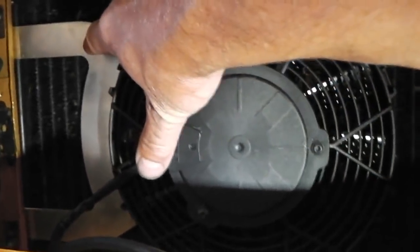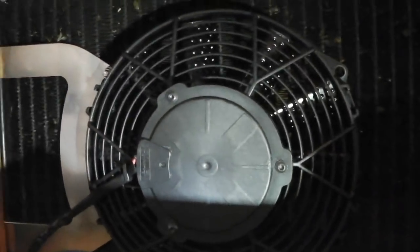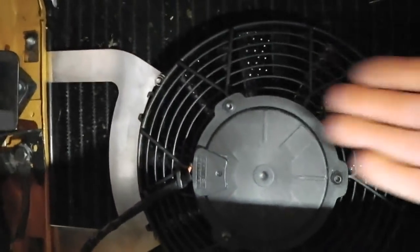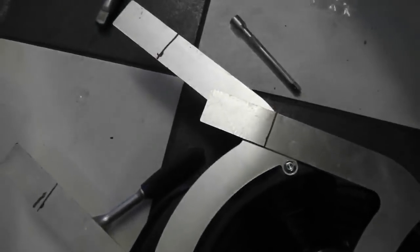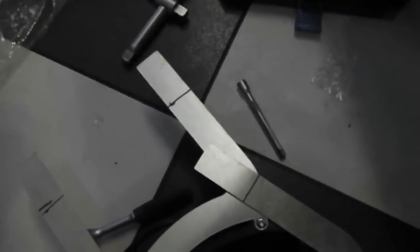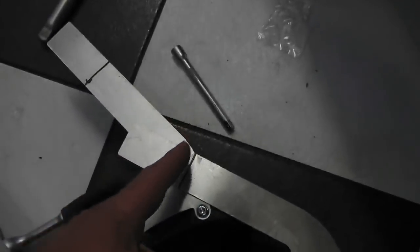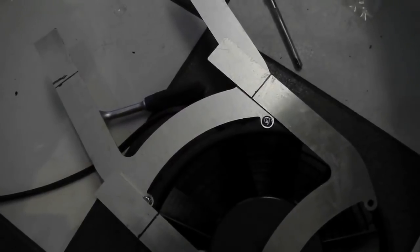Then we can mark this bracket now in the engine bay. I can't fit the other bracket, actually, it didn't work sliding it all the way to the left because it catches on a clip. So I'll mark this one, we'll cut both brackets. In theory, both brackets will cut the same. Then we can slide in that way and then slide back that way. Should just about work. That's how we're going to fit. Okay, I've marked out the brackets for cutting. 60mm off the end lands us right in the middle and just sandwiched nicely between the rad. So we'll slice those down now with a slicing disc, and then we can actually bolt this one up.